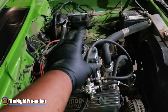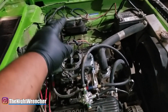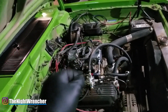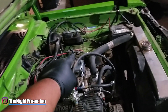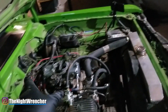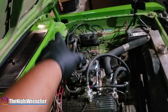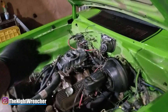You really couldn't notice it; you just knew it was running rich. Now I've checked there are no internal or external leaks. What I'm going to do is set all four idle adjustment screws all the way in, then bring them out one and a half turns. All four corners will be brought in all the way and then backed out one and a half turns. I'll do that while it's off, then restart it, keeping the idle up so it doesn't have a hard time starting.